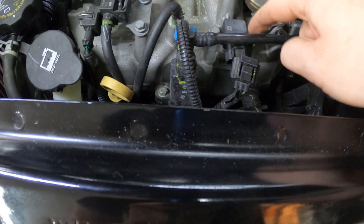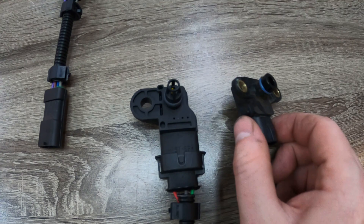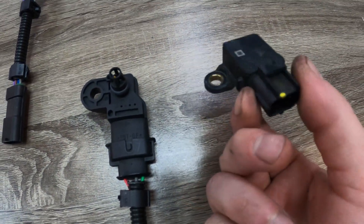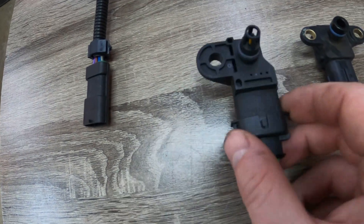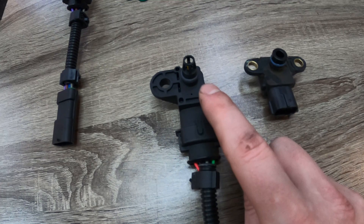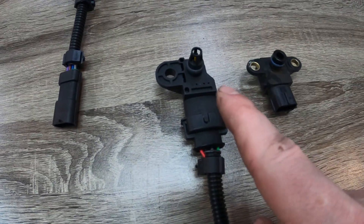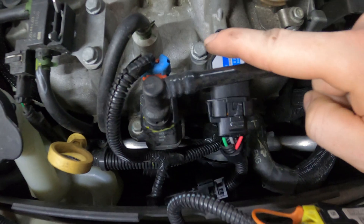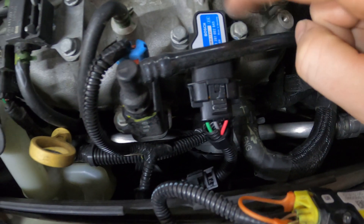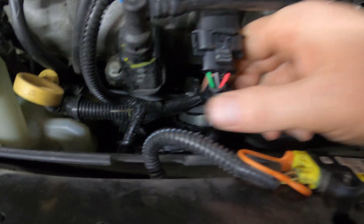There are two 10-millimeter bolts here — let's get those out. The stock one right here has a blue o-ring and two bolt holes, and there's the connector. Here's our Bosch one: one bolt hole, has a blackish-looking o-ring. I'm going to attempt to use what's on there. I attached the right bolt and put the other one in the hole so I don't lose it. The black o-ring on there fit right in — was real tight — then I gave it a little shove and it's pretty flush. The pigtail adapter is on there and we should be good to go for that one.